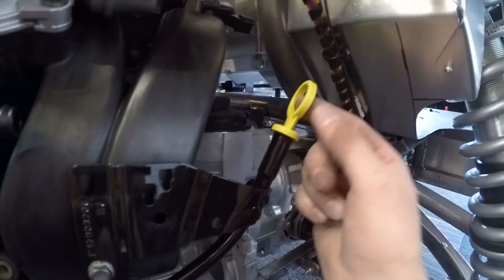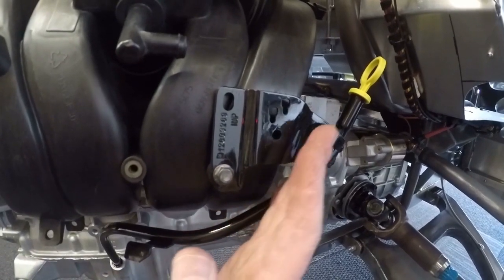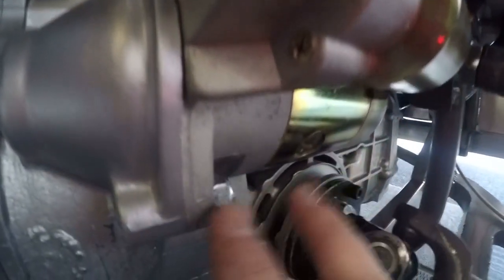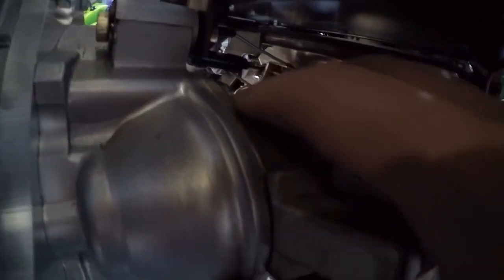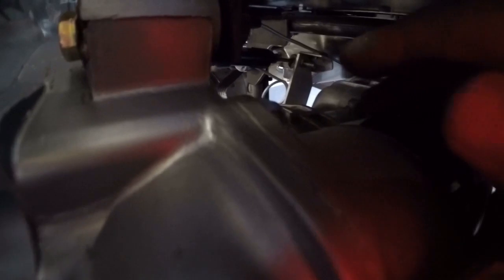This is not a major deal, but this is the oil dipstick — I doubt I can get it out here, and it looks a little dorky. I'm probably going to change this bracket and make it come more up this way so it's a little more usable. Down here, this bolt on the starter — they've got this little groove in the starter housing and you can't just back that bolt off. You have to take both bolts off at the same time and slide the starter back, and you can only get a combination wrench on it — you can't get a ratchet on there. Because of that, accessing this bolt for me is almost impossible.